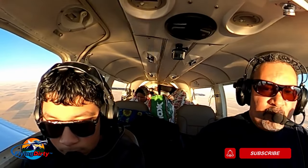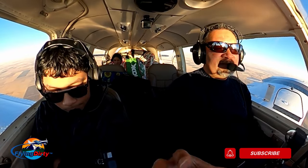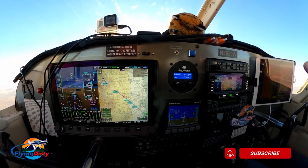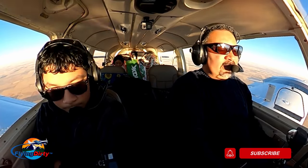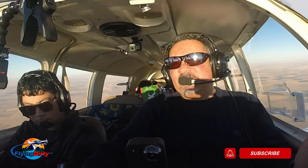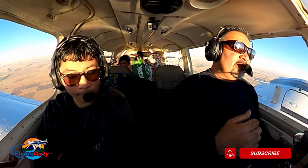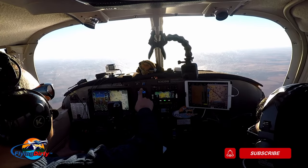I bought the TrueTrack because it was the next best thing — I was committed to the Dynon system. At first I was going to get the Garmin G3X, but after seeing what Dynon can do alongside the Avidyne and the iPad setup, I really like Dynon. Most people have a problem with the D10A because sunlight from the left angle can wash out the brightness, so I put mine down lower and I haven't had a problem with the display brightness at all.